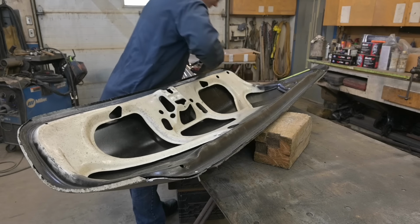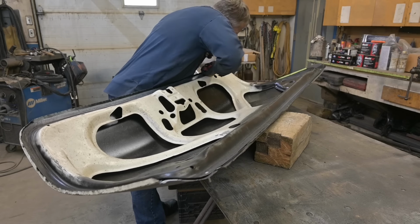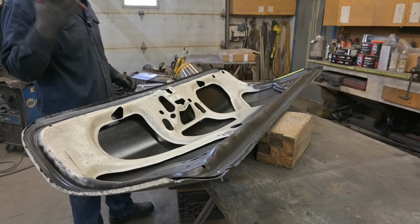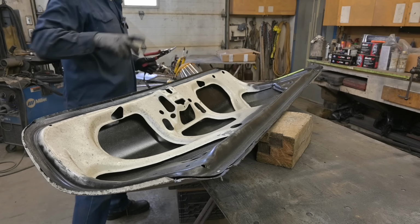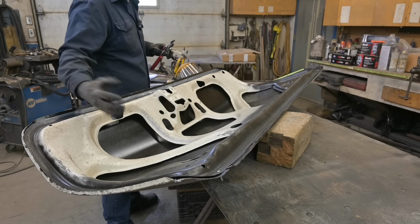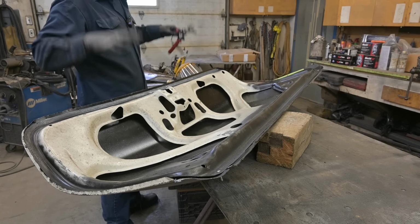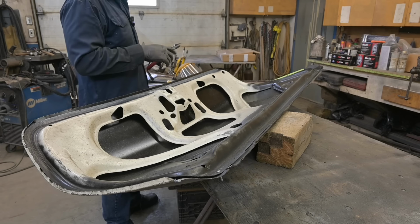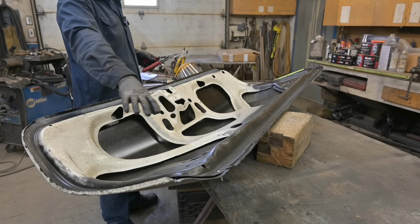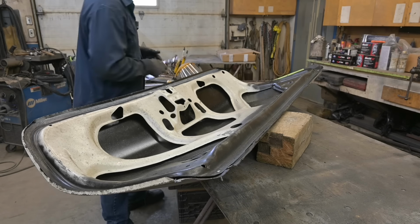A little more. Now we're going to throw this up, like I mentioned, but it probably won't fit. Oh, we can maybe adjust those corners. Stand the flanges up a little bit because some of them are opened up more than 90, so that'll prevent it from sitting down properly. But what we'll do is just stand them up, clean them up. The front edge, we're going to leave that for now. Get this in place after we roll this. Take a look.